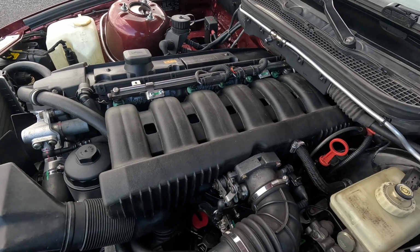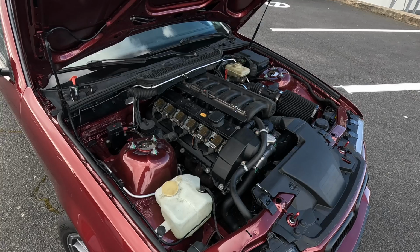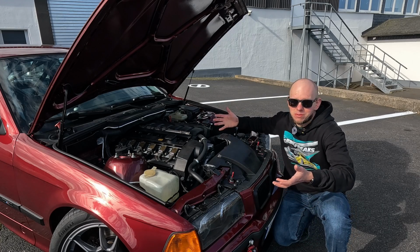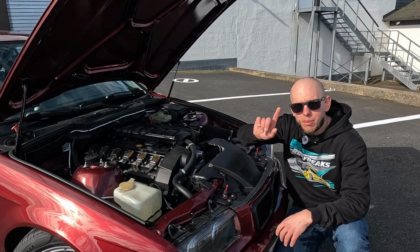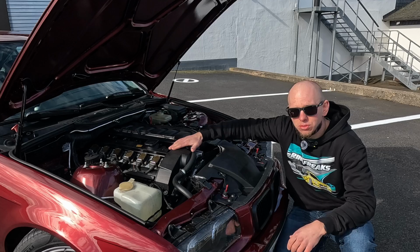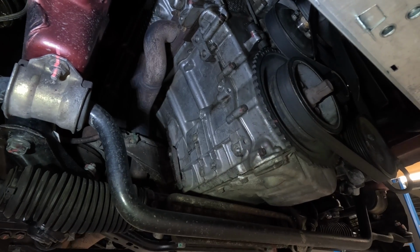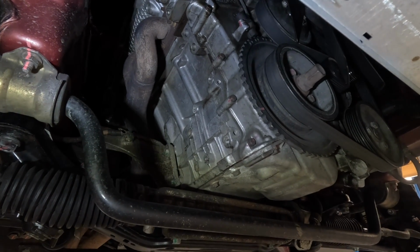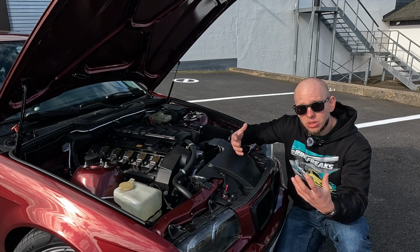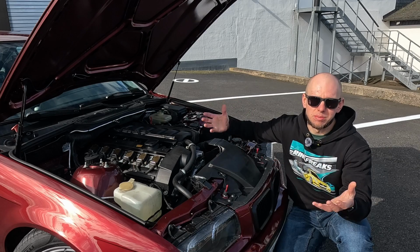So if you take the 323 model with the 2.5 engine and replace the intake manifold with the one from the old good 2.5, you actually have the same 2.5 engine with the same power, but you have a very big benefit. When you have a 323, the same 2.5 engine comes with an aluminium block, which is about 20-30 kilos lighter than the cast iron block. So you could convert the real 323 to the same power as the 325, just with a bit lighter front.